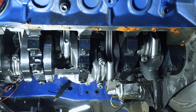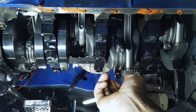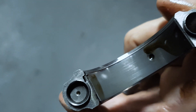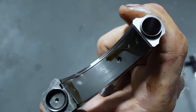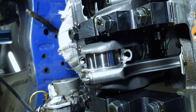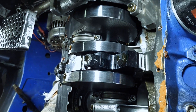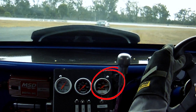So it's got all the good stuff, all looks clean, no discolouring on the crank — but this will be the telltale. Well, it's basically brand new. A couple of little light marks in it, probably from assembly dust or maybe a bit of dust in the filter when it went on. But I'm more than happy with that. Journal looks brand new, everything looks brand new. So after a thousand k's and quite a few laps with no oil pressure — I'll add that into the video.